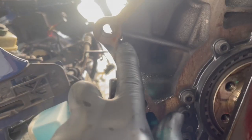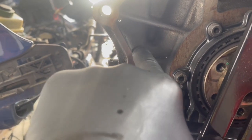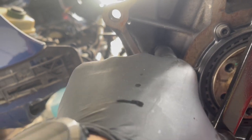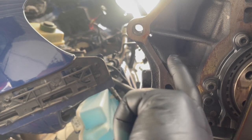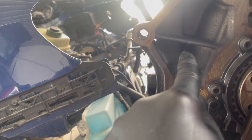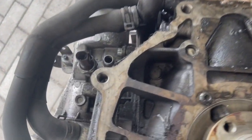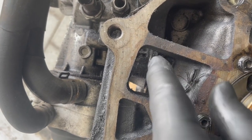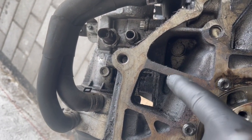You can see the bolt — the head of the bolt is right there. There's a little fat area that I think is the bolt channel, so I can go above that. The face on this side I can cut away, but that back wall is actually part of the block, so I can come in this way and that way — like a triangle, and a little square piece in there. I'm going to try to remove all of that. This is what it looks like now: the whole area is cleaned out, and you can see the main part of the block and the oil cooler in the background.